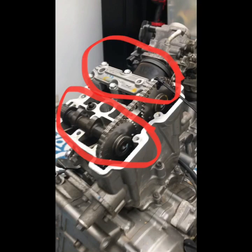If you want to change the exhaust shims and the intake shims, if they all need doing, I would suggest doing them one at a time, leaving the cover on. As you can see, the intake side still has the cover on. Change the shims on the exhaust side, then put the cover on the exhaust side, and obviously take the cover off the intake side, and then you can pop that cog out. I think it's a lot safer if you have one of them fastened up. That way they're not both going to pop out, and it will be less of a headache getting everything lined up at top dead center.